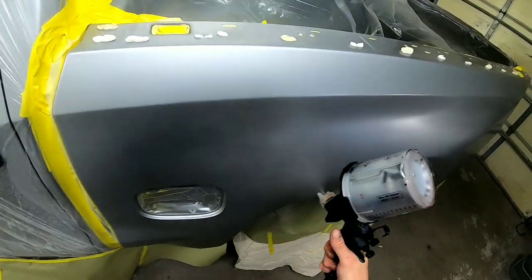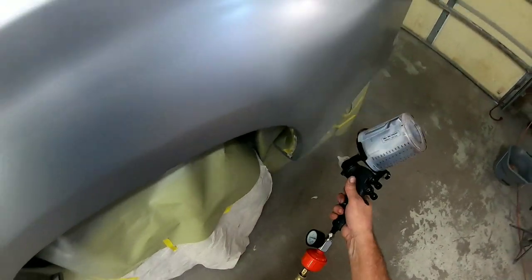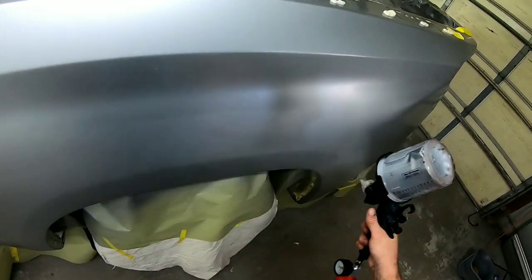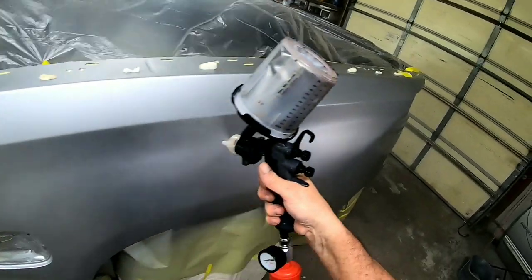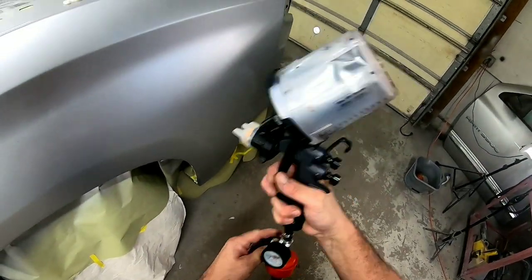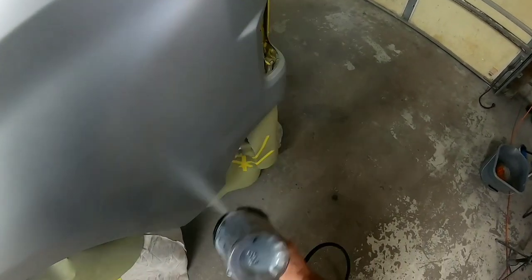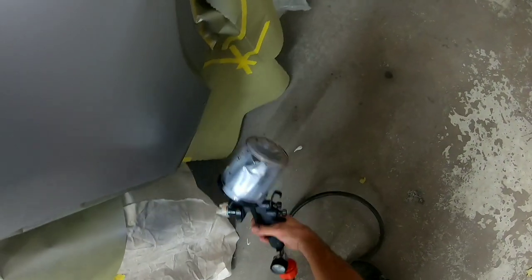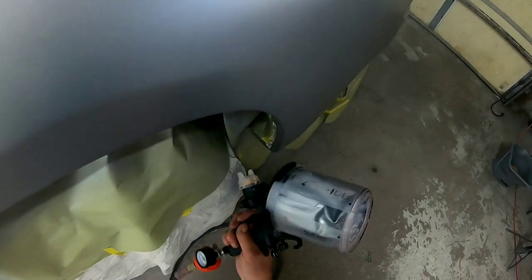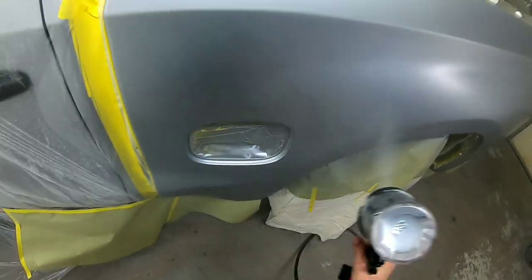I hope you found those tips helpful — leave me a comment down below and be sure to like and subscribe. Now we're finishing up the paint on this panel and getting to clear coating. I'm finishing up the blend here, blending outside of the primer area. When you're painting, make sure you get the primer covered so it's not transparent — you can't see any primer underneath your paint. After you cover your primer, you blend out into the rest of the panel to give that consistent metallic finish.